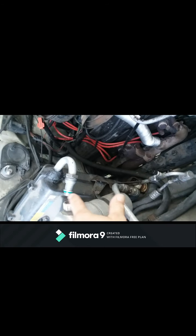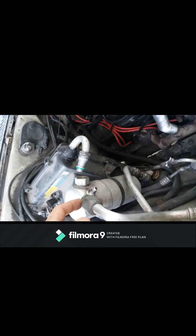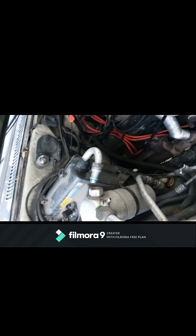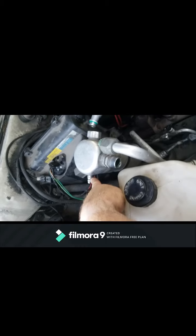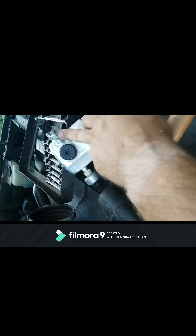You always want to make sure you replace these seals — there's one here, there's one on this hose. There's also this seal here which is for the pressure switch, which I've already put on the new one right there. I also put my adapter on here — this is for the R134, because this is an original R12 truck. You can see right there that's the original AC sticker. It's old enough it still used R12 when it was new.